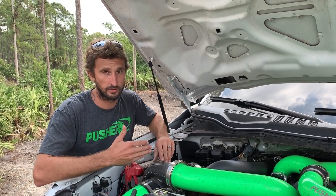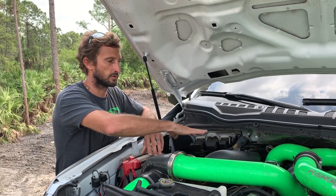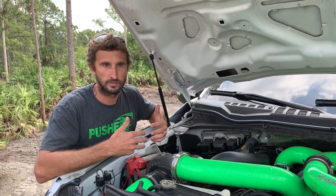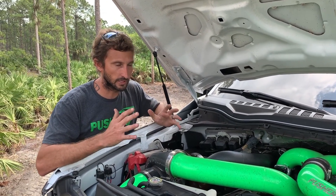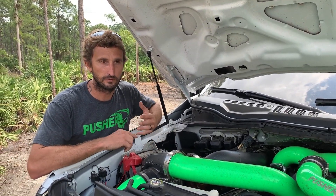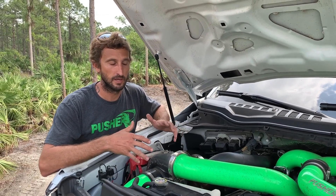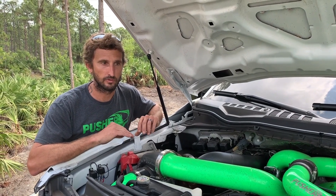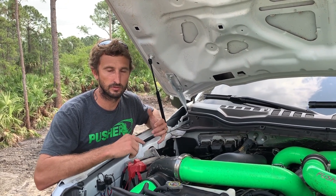In my opinion, one of the most important components of a compound system is the turbo mount bracket — what's tasked with holding the charger in place. That charger weighs right at 50 pounds, so rigidly mounting it to the engine so that load is not transferred to other components is very important. It's hard to see in this truck, but our install video will definitely show it to you. This kit, just like our other kits, is 100% complete — it comes with every nut, bolt, washer, and coolant line you're going to need, plus a full set of detailed instructions. It's intended for a handy guy to do in his driveway, or a shop will have everything they need without running out for hardware.